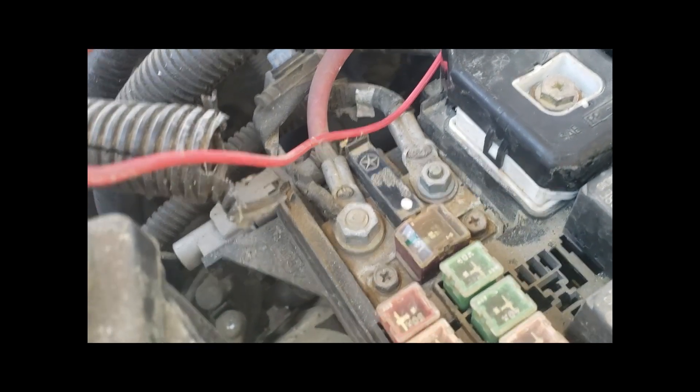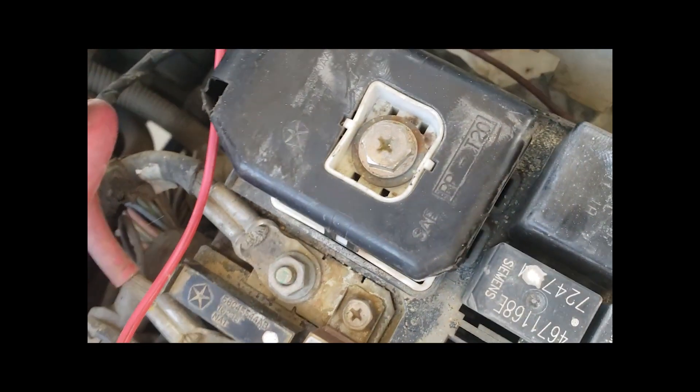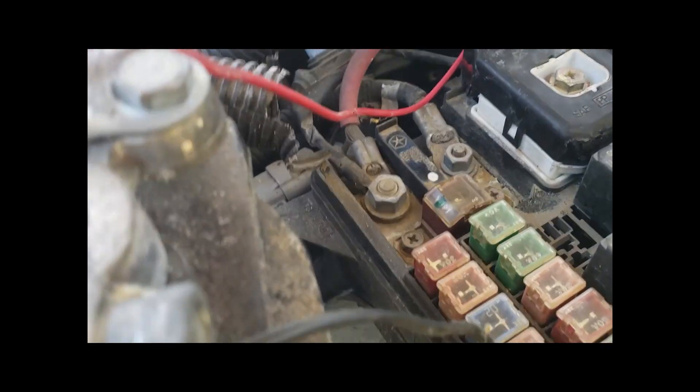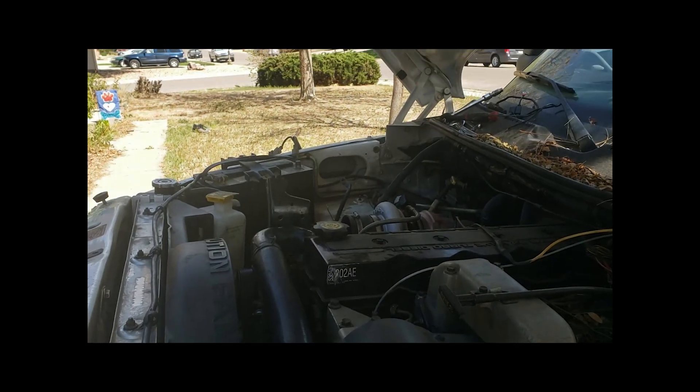And this is a relay — it's 140 amps — so you actually don't need that. I'm just going to use the circuit breaker instead of a relay so you can get it back home. And then if it charges too high, it'll pop it. So you can reconnect it factory style, but it's a lot easier to do it the other way. Basically what you want to do is get that and undo it and then snake it back over this way.